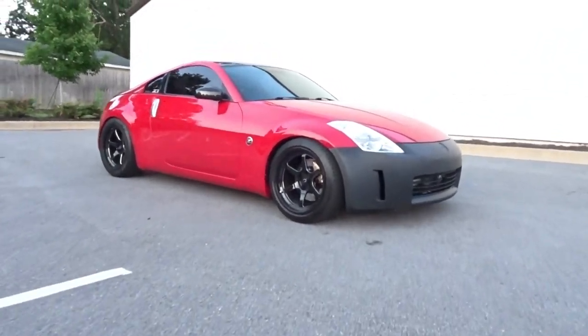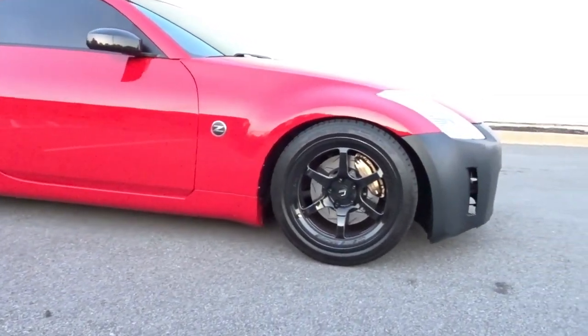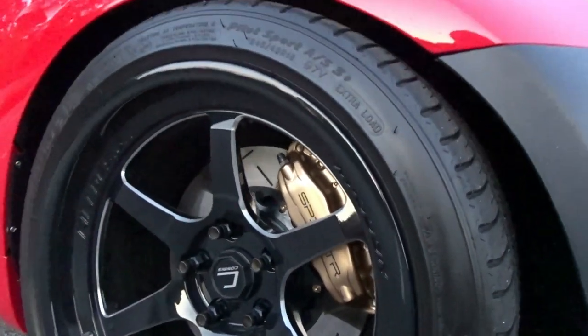Hopefully this video was at least a little helpful as a starting point for understanding preload and what it can do to your suspension setup. You can go adjust your preload to the standard manufacturer-suggested setting. I went a little beyond that five millimeter standard in the 350z, and we're going to do the same on the Q50 to see if we can reduce that sagging issue and get it riding a little more stiff. Hope you guys stick around — we've got over 450 videos on YouTube. Thanks for watching, and we'll see you in the next one.